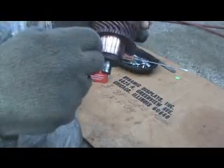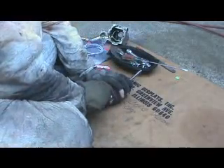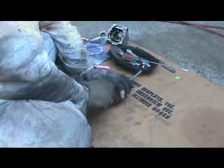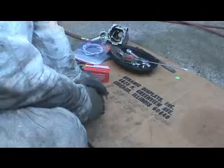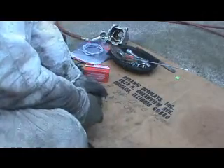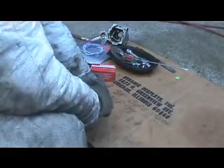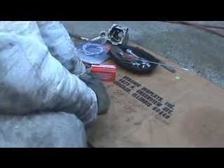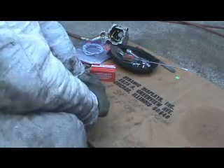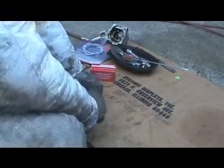I want to clean between these commutator plates — by doing this it will extend the life of this unit. I'm just using the sharp edge of a screwdriver; just about anything works. It doesn't matter if you scrape them. The main thing is I'm just cleaning some of this Bakelite material out of here so there's a little bit of space in there, because that's how this current makes this armature turn magnetically.